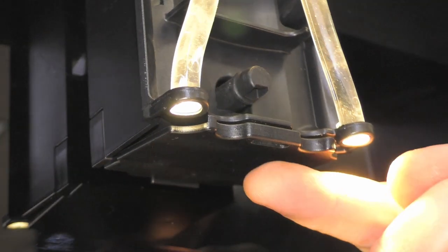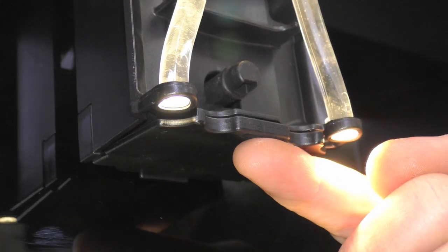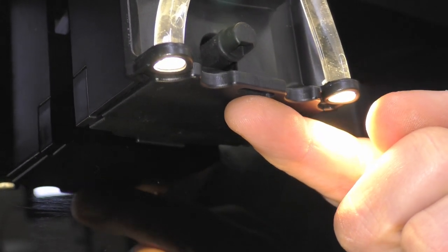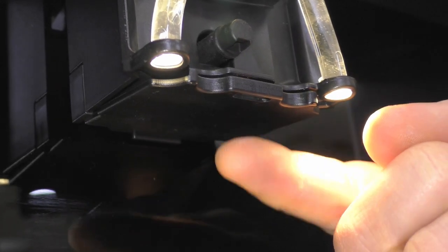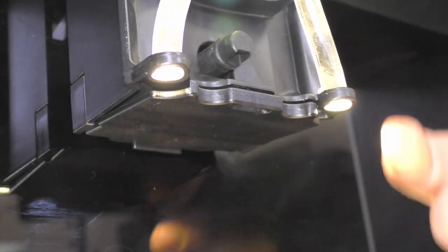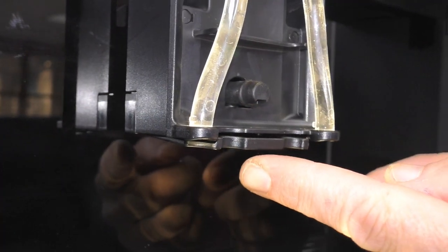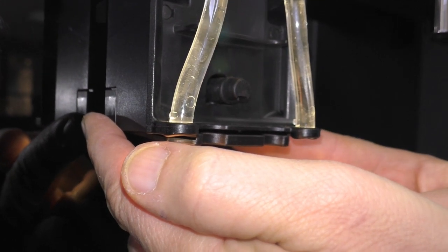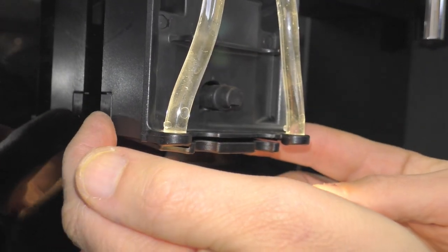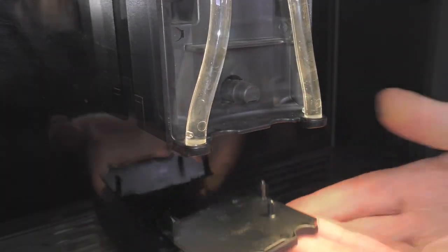The sensor cover is located here. As you can see it moves. If you listen carefully you can hear that it's actually activating a micro switch which will stop the dispenser assembly from extending any further in case it contacts a cup. To remove the sensor cover you'll see there are clips here and on the opposite side. I'm going to depress both at once and the cover will drop.